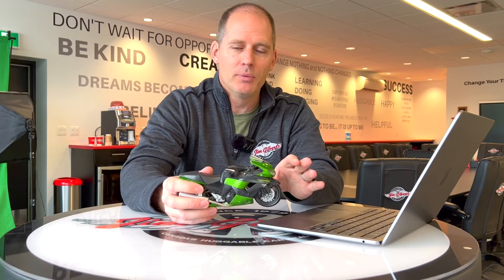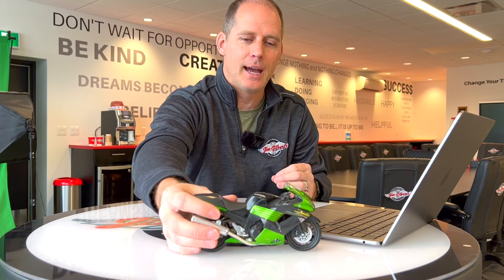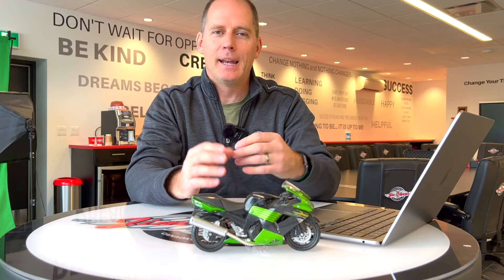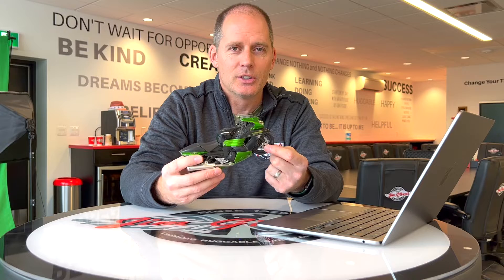On its own that's interesting, but it works with many of the other systems. The key thing to know here is that Kawasaki has proprietary software to work with their bikes on some of these things. It adds things like — for instance — a regular bike might just have ABS. Now, ABS is not part of the IMU. ABS uses the wheel speed sensors and makes decisions. So if you just had ABS, you could then have traction control, because ABS measures wheel speed sensors, and so does traction control — same hardware, different software.